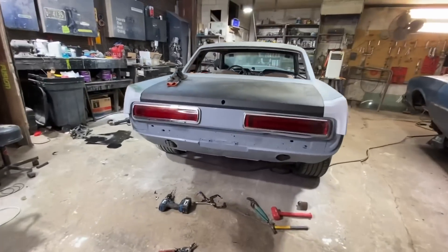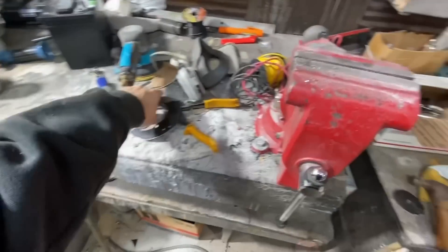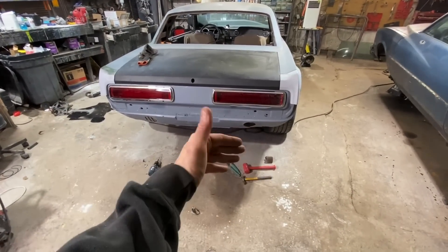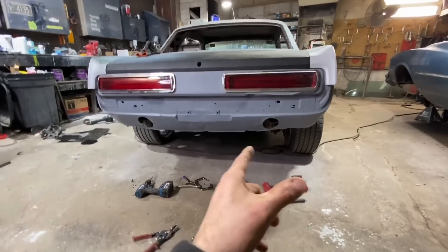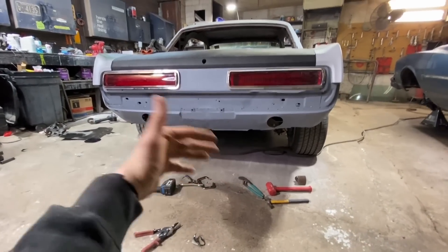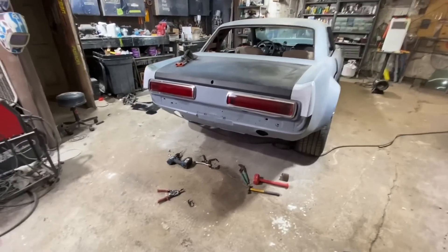I wasted over an hour trying to figure this out - my reverse lights do not fit in those holes at all, they're just way too small - the hole is way too big. I looked them up, I ordered all the right parts, I don't know what's going on. I was like, I'll just make a quick little piece of metal that'll go in there and I'll weld it - hated that, looked like garbage. After all that, screw it, we're just gonna weld these up. I can't straighten up this valance until I get those welded up because no matter how much I move the metal, since there's no metal there it's just wiggling around. So I'm gonna weld it in, that'll give it some more structure, and then I'm actually gonna tie this rear piece into the frame rail so they're not so wiggly. As always, rushing my ass off and then wasted like 90 minutes, but let's weld.